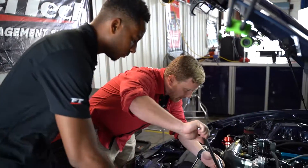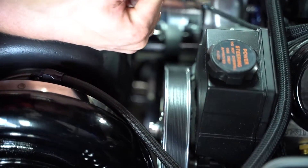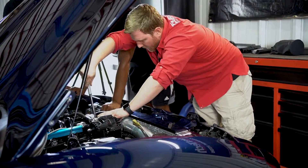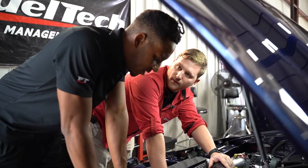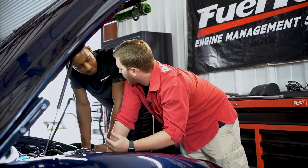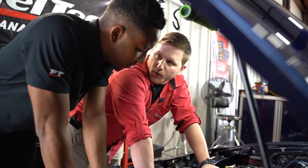Let me get this down in here again. You can see the lines on the damper — we're going backwards with it: 30, 40, 50. Now we are 50 degrees before top dead center. If you look at that pointer you can see the very tip of it points right at the 50-degree line on our damper. Let's go back up and I'll show you how everything kind of relines up, explain why we're lining it up this way, and then we'll grab the laptop and do the stuff on the computer.